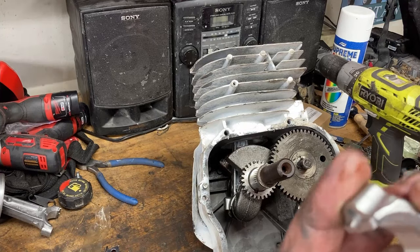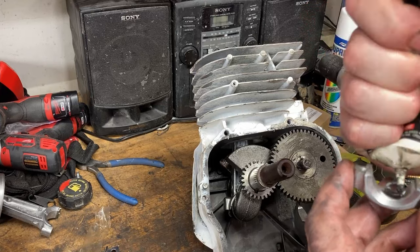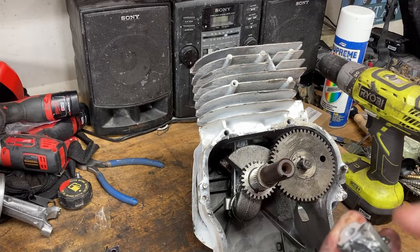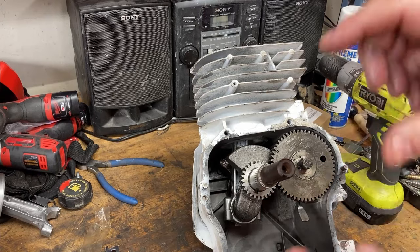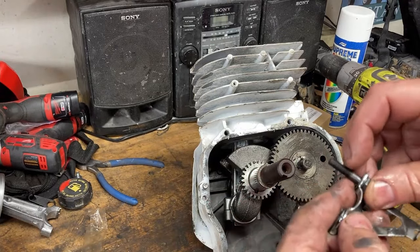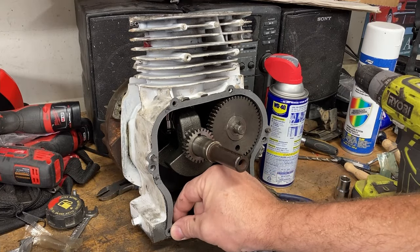Before we put our piston in, we made a little mark on the cap so we know that that goes to the inside of the motor. So we assemble our cap on the connecting rod the way it came out and the way it was machined. And again, with a generous amount of pre-lube here, we install our cap on our connecting rod. You should be able to just press it and it'll stay in place. You get your oil splasher and your nut keeper like so. Install your bolts through the two little parts here. Okay, and installing our side cover, easy, easy.